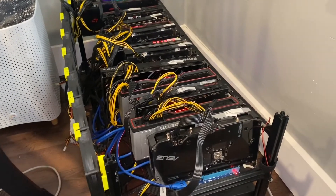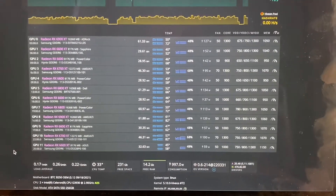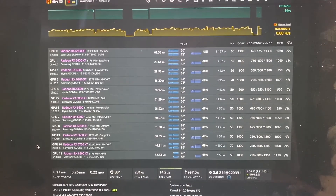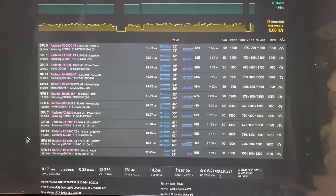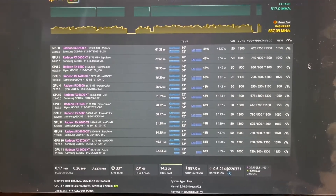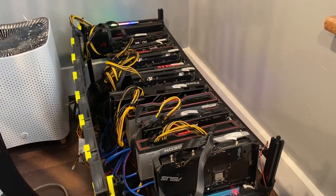Here you can see GPU 0 through 11 — 12 cards — everything is great. It shows BTC 250 OEM. The BIOS was probably flashed right at the time it was bought, and it's likely just a clone of some other name brand motherboard BIOS. The only gaps in hash rate are from when power supplies died and the rig went offline. It hasn't gone offline on its own for any stability issue. I don't see any reason why this wouldn't work with NVIDIA cards or a mix — though AMD cards with all that VRAM are arguably harder to run.